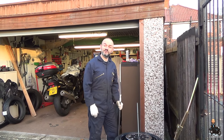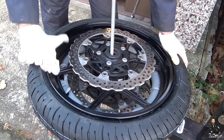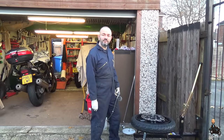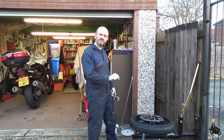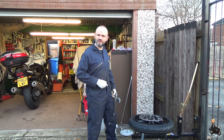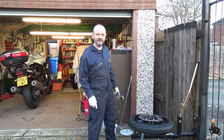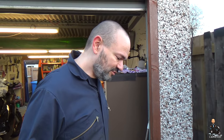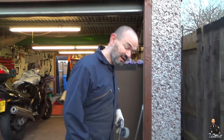With a little huffing and puffing, it's up. The key part of using the nylon-headed bar is there are no scratches or nicks in that powder coat. We now need to seat the tire into the bead. One thing quite a lot of tires have is a little yellow dot, which is a balance mark that you position opposite or against the valve. PR4s don't have them — Michelin claim the tire is perfect anyway, but we'll see. I'm going to balance the tires later, maybe in a later video. To seat these beads, all we need to do is pump a lot of air in — get the pressure up and you'll hear two bangs as the beads seat into the grooves. Wish me luck!